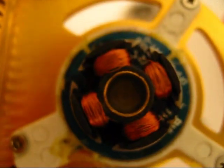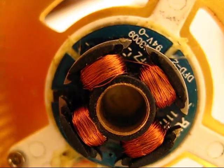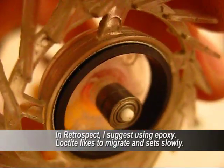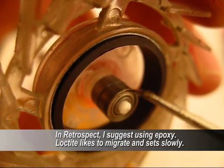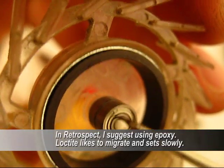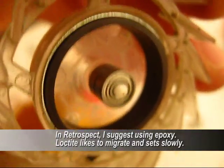As far as these bushings go, they're looking pretty good and everything fits together really well. I'm about to get the Loctite out, put the bearings on the rotor with Loctite, and then ever so carefully put the tiniest bit on the outside of the bearings. Of course the risk is that the Loctite gets in between the races and locks up the bearings — definitely don't want that.